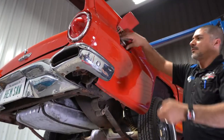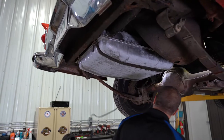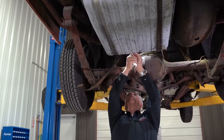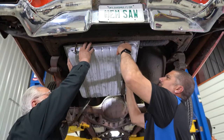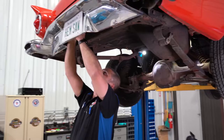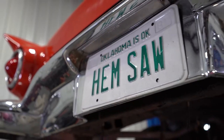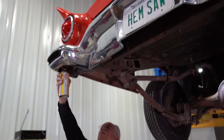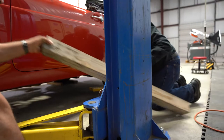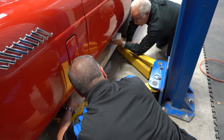Before you go ripping things apart, you've got to take a look and see what needs to be addressed. For instance, the exhaust pipes are bolted to the bumper, so there are exhaust clamps and exhaust coming through. We're going to unbolt the 3/16ths, remove the exhaust pipe, remove the gas tank because two of the mounts are held on to the body, then remove the brake fluid, and check that all wires connected to the chassis — like the license plate wire — are disconnected. Then we can attack the body-to-chassis mounts themselves. Everything's already been sprayed with PB Blaster, so it should just come right apart. We've got 4x4s to place underneath the bottom of the rockers to distribute the load and prevent flex as we lift.